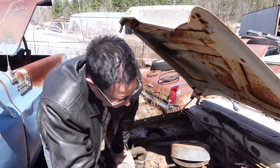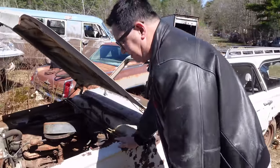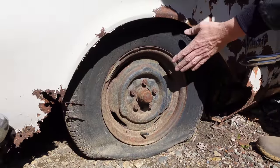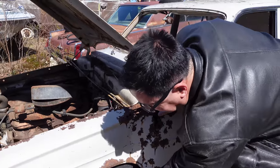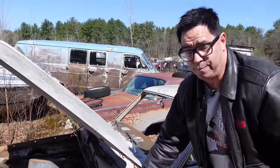The tin worm has totally made a mess out of this car. These are the 13-inch wheels seen on virtually all Valiants, though a 14-inch rim option existed. The Mopar small-bolt pattern here is a five-on-four-inch bolt pattern, not the five-on-four-and-a-half-inch pattern seen on the B-bodies and C-bodies.